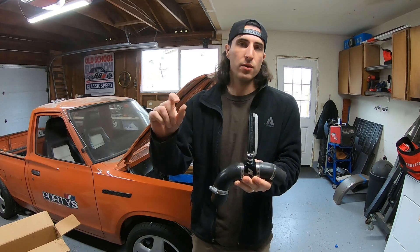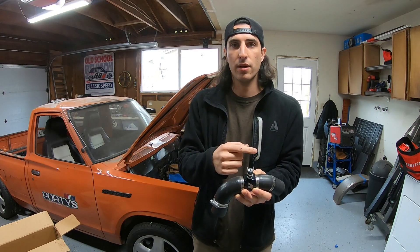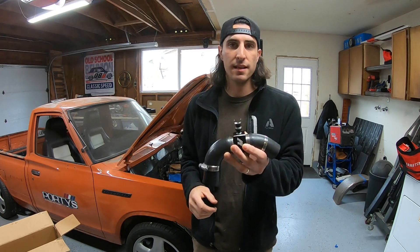For the wiring: you have your relay with an ignition power source to the trigger side. The relay then grounds through the temperature switch, so the feed coming off the relay goes to the fan and then to ground. Alternatively, the switch can feed out to the relay trigger, and once the switch reaches temperature it trips the relay, sending high-power current to the fan. That's how it works.